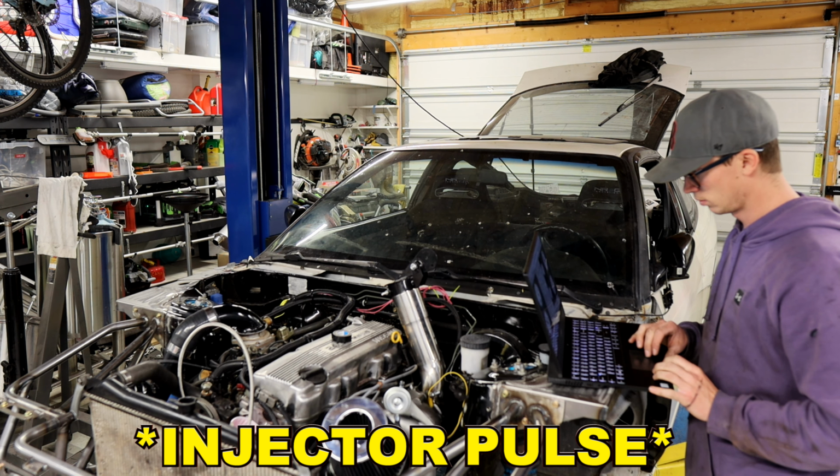All right. We got oil in the cup. I was really concerned we weren't gonna get oil up to the head, but we've got oil. Looks good. Doesn't smell like water or anything. I was a little concerned that the front cover was gonna leak some water into the pan. I don't like the design of the front case on these.